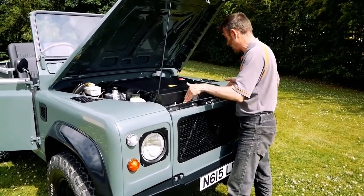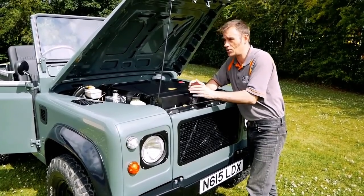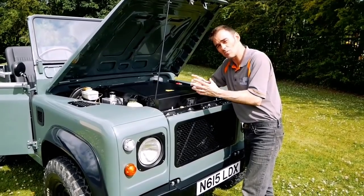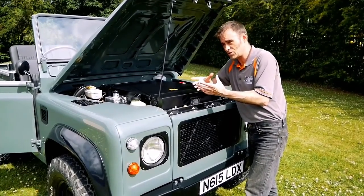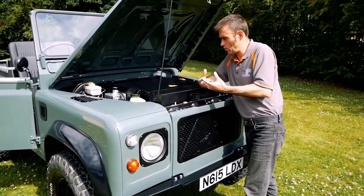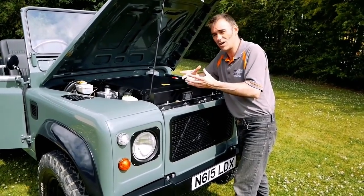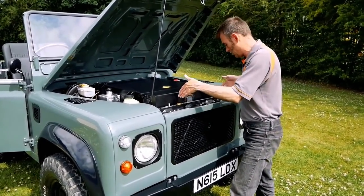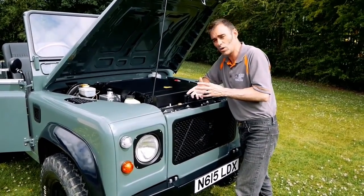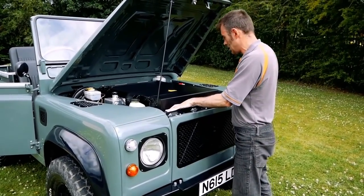The radiator here is because this is a Tesla motor - a Tesla large drive unit which usually sits in the rear of a Tesla Model S. That's an induction motor, and it's quite efficient but not as efficient as say a permanent magnet motor. What inefficiency brings is heat - an induction motor generates heat. That's why you need a radiator to manage that heat. The actual controller in the motor can also get quite warm, so that's why we've got radiators in here.